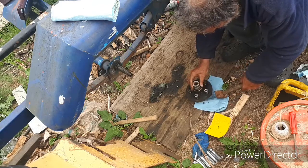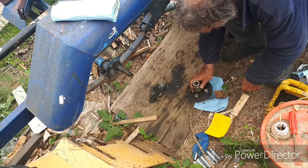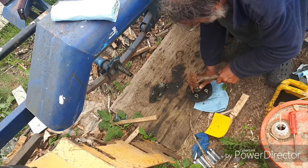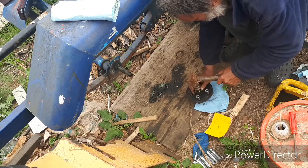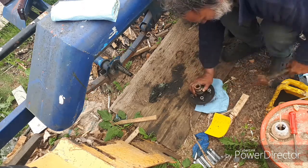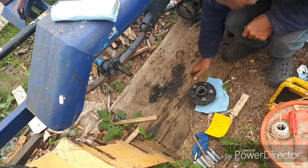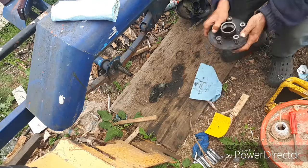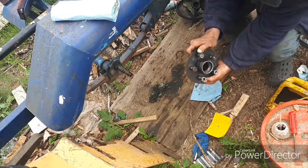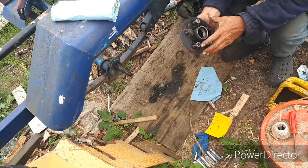Like I say, you can buy all kinds of bearing kits for hammering bearings in. But the best thing that works is a 3/4 inch drive set. It has the perfect size sockets. You know how it went solid thump? That indicated that we bottomed out. Okay? And you just look to make sure that you're bottomed out on that ledge there.